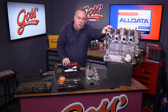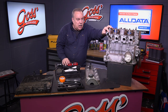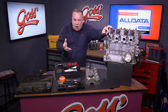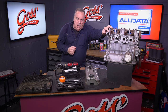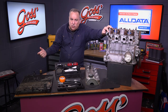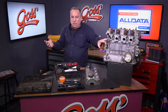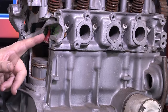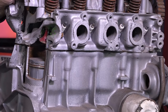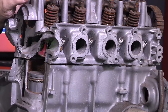The next thing we do, if we haven't found the source of the air leak yet, is go to the air filter and throttle body. We open it up and listen at the throttle body to see if the air is coming out through the intake. If it is, that tells us we have a problem in the upper part of the engine — one or more of the intake valves are not sealing properly. So we're isolating this to the bottom of the engine or the top of the engine.